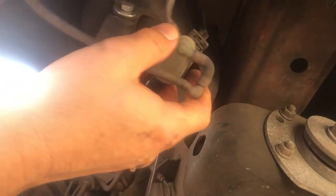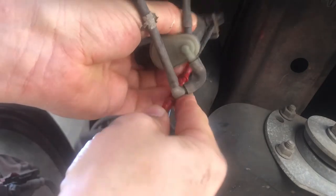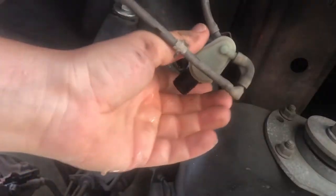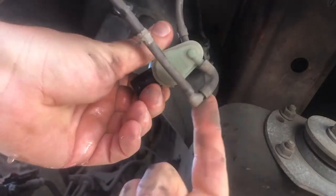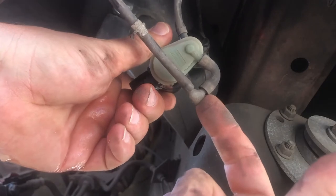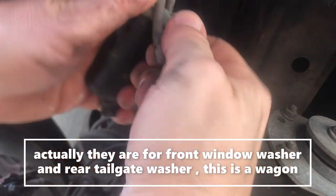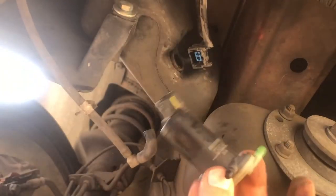Here's the pump. We just take off the old one and put on the new one. There's an electrical connector at the top with a little wire clip - just loosen that with a screwdriver and it should just come off. Don't lose the clip. These are the two pipes for each side - driver's side and passenger side. Just pull those out. There's the old one.